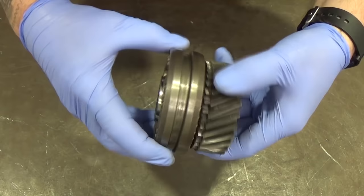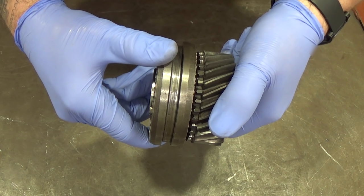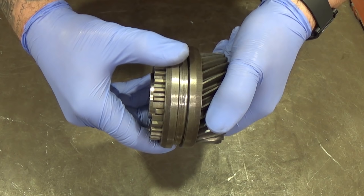So if we put it all together, you can see as I put some force against the cone clutch — friction takes over, synchronising the speeds of the gears. Once the speeds have been matched, further force allows the outer sleeve, via the baulk ring dog teeth, to be guided effortlessly onto the dog teeth of the main shaft gear, locking it all up as one unit.